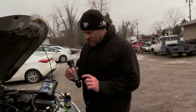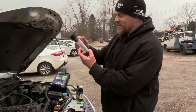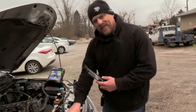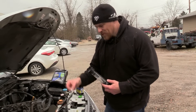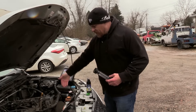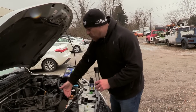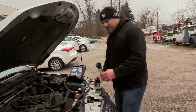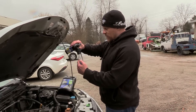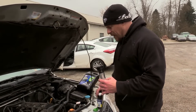A couple things I learned about the tool. One: there's a check ball in there that keeps the fluid from running back out, and that check ball stuck on us. Two: you definitely don't want to fill it to the upper line because it'll pull it into the intake manifold — first line for sure. And you saw how much it was bubbling, so that's why they give you the different adapters — to kind of bleed some of that vacuum off. I believe what we just saw was the system burped and it filled the overflow bottle. As soon as I pulled this away, the fluid level was full in there, and it pulled it all the way back down. That's why it turned that color — that did not change color from a head gasket issue.